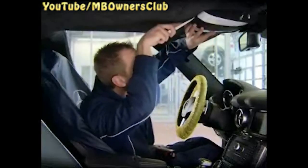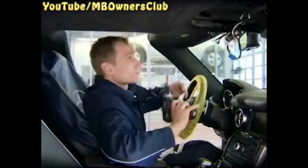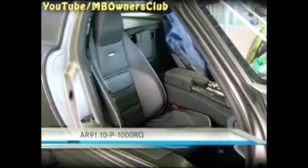To remedy this, first remove the sun visors and the cover of the rain sensor. When taking off the roof operating unit, pay attention to the plugs. The front liner is fastened to the car body with two screws — with a screw gun they're removed quickly. Test using a feeler gauge. A wedge helps to unclip the roof liner. Make sure to disconnect the two plugs. Remove a seat so that you can take out the rear shelf. For more details, check the appropriate VIS document.